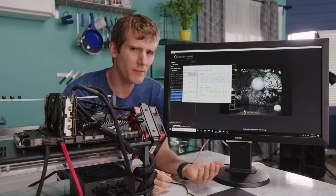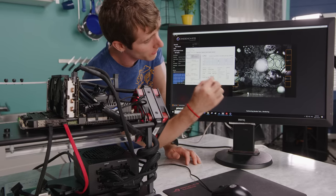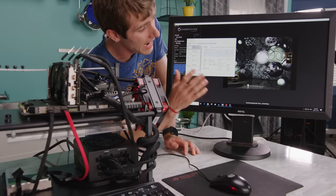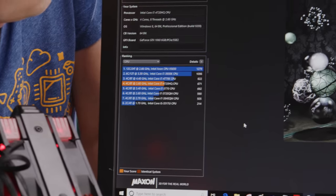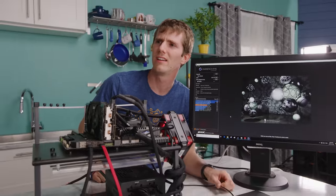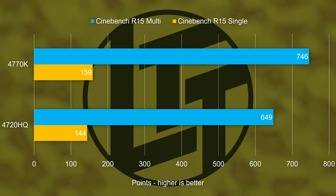That's kind of expected because our low-core-count turbo is a little bit higher than our all-core turbo. Running Cinebench now, maxing out at 3.4 GHz — our score is 671. A 4770K scores 746. That's definitely going to be a noticeable difference if you're actually doing any 3D rendering or video editing, but probably not the end of the world.